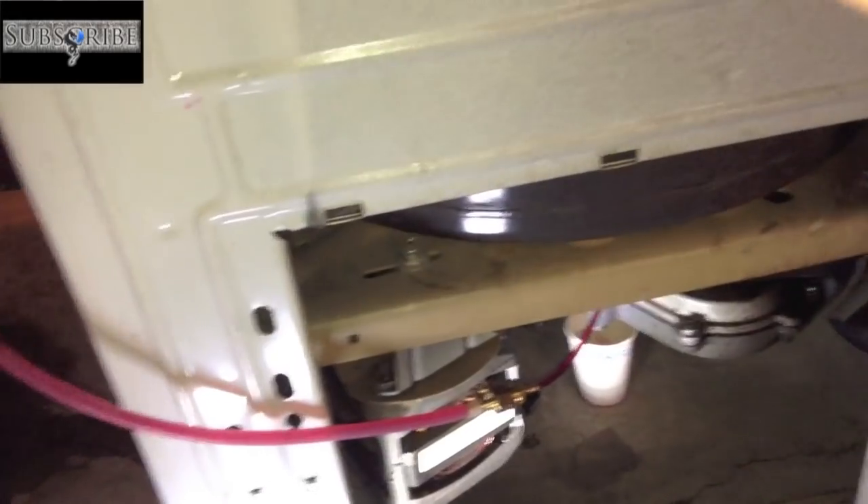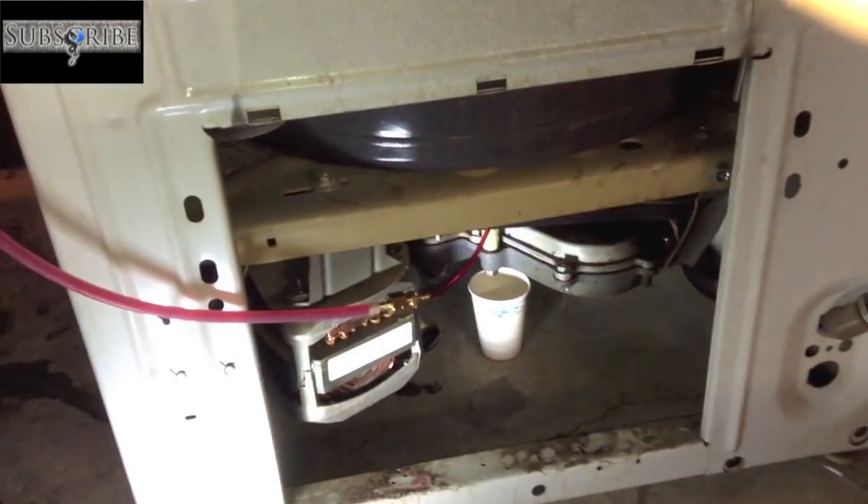You can kind of see the level rise right there. It's been about an hour since I got the transmission filled. I went and plugged it in, hooked the drain line up, hooked the hot and cold water lines up, switched it over to spin and rinse cycle. No luck - did not work. Everything sounded better, the weird grinding noises kind of went away, but it did not spin.